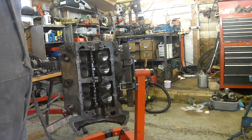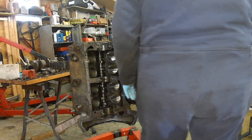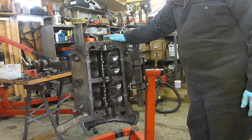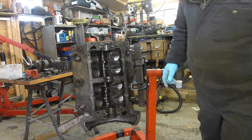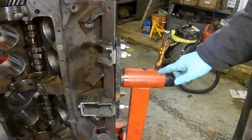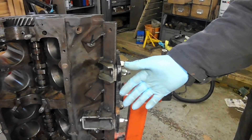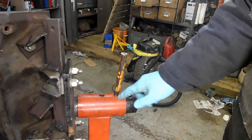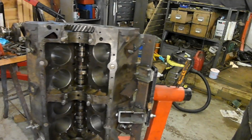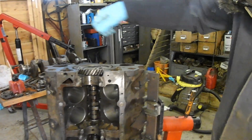What I intend to do now is fit the valves, but first there's a couple of things I wanted to show you. One of them is that I've modified my engine stand — I've put another hole in it that makes it closer to vertical. I drilled another hole there, which made it easier for putting the cam in. You can just sort of put it in nice and easy like that.